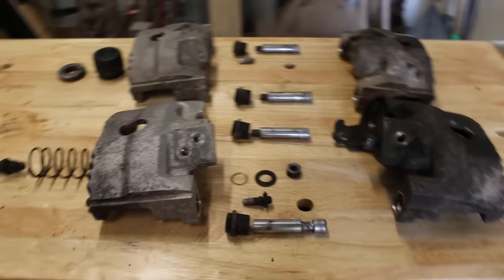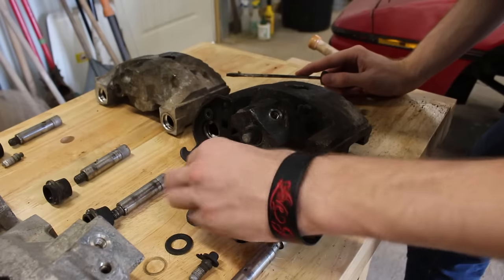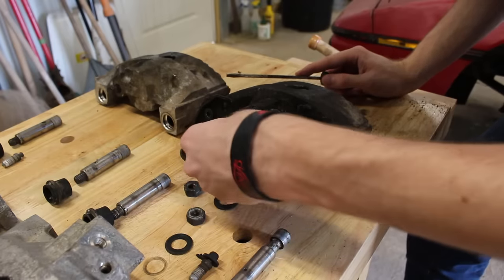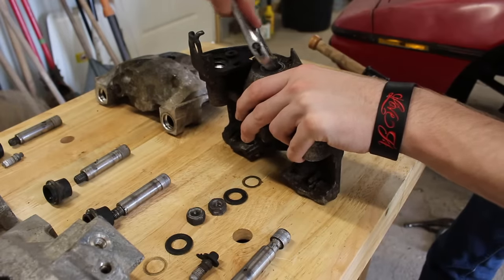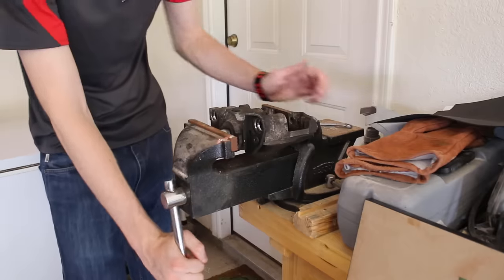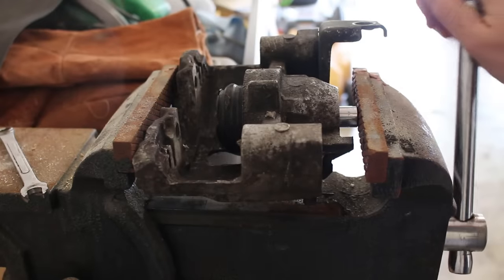To show how the left ones came apart, I'll take you along with the right side. The remaining washers were taken off the back of the rear caliper. Then the lead screw was rotated as far in as possible — maximum thread engagement is very important here, since the whole thing is going in a vise. And the piston is pressed out with the help of various sized sockets.